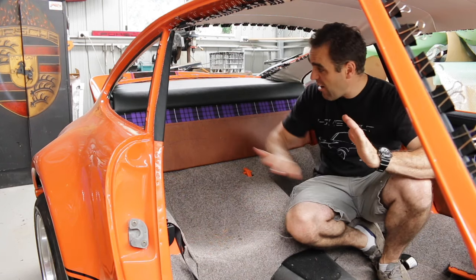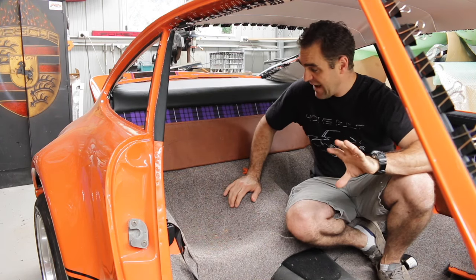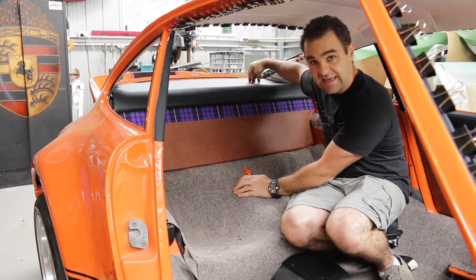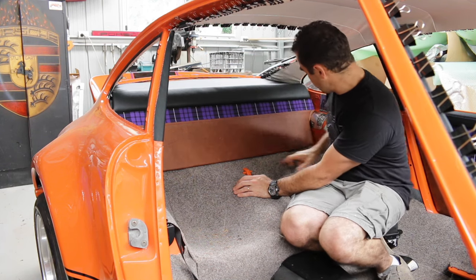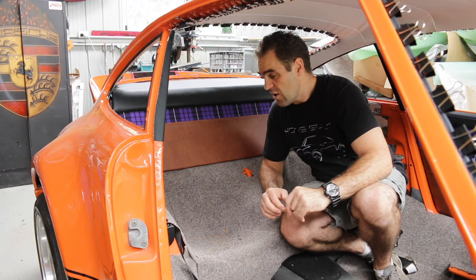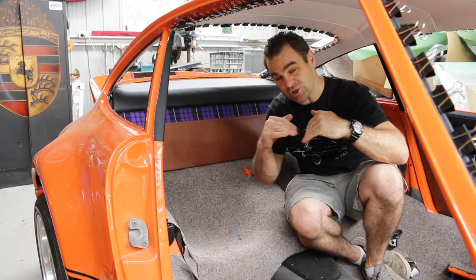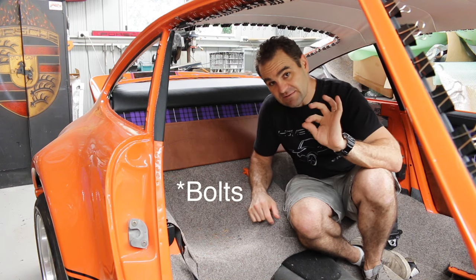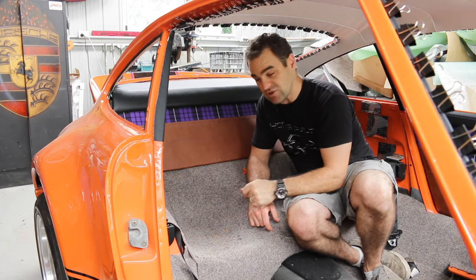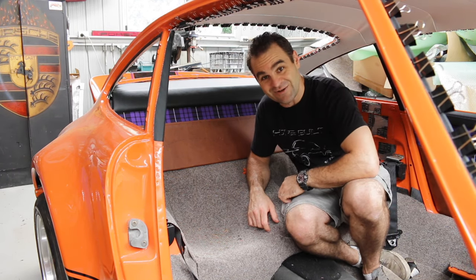As you saw a couple of weeks ago, I made this rear piece and some of these other panels. They're just sitting there, so I need to go around now and mount them in properly. This panel up here has a couple of bolt holes in the back that I can actually bolt into, and there are also a couple of spots through here with factory mounting points where there was a small screw going through before. I'm thinking I might drill, tap, and put some riv-nuts in there. I'm ordering a bunch of cup washers with countersunk Allen nuts so I have a nice neat finish for all the interior bits. I'll go through now, mark these holes, cut them, and hopefully I don't wreck this panel that I spent so long building.